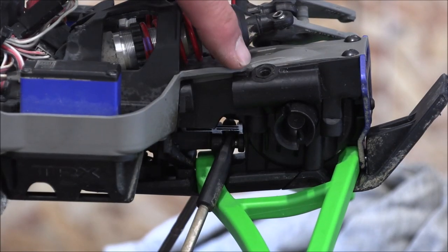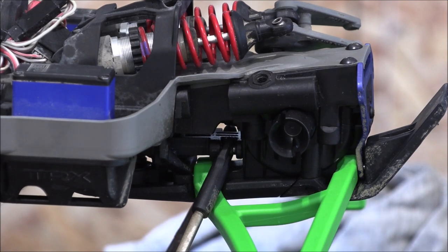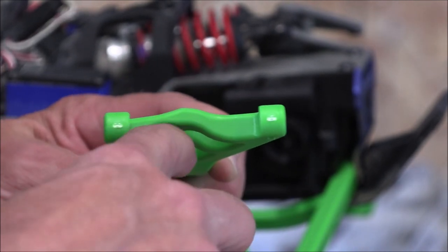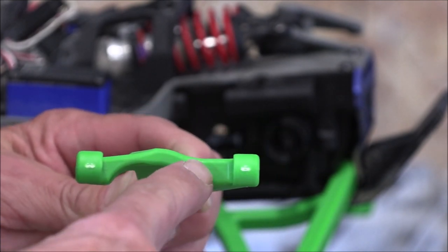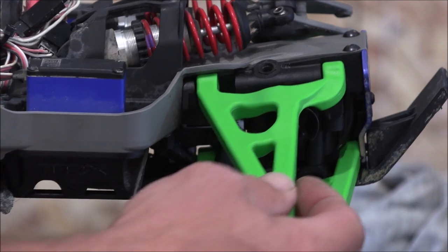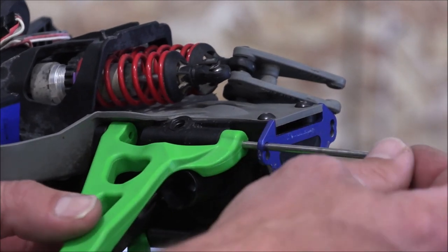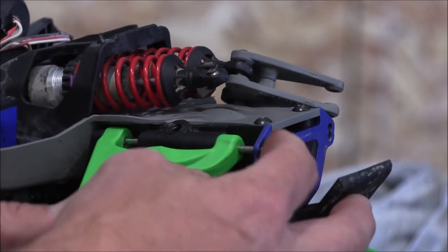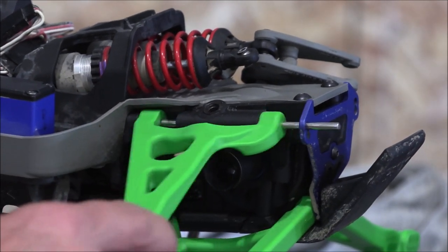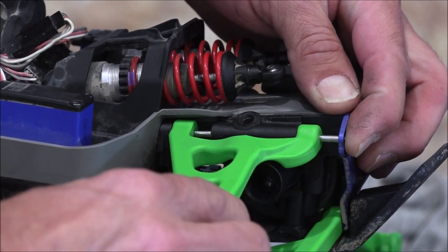I went ahead and took my rocker off just to give you a wide open view of where these go. So you've got your control arm here - push your pin through the top hole, which is the stock position. Now most people would think you're good, but no - this is where those spacers come in. This is what caster is: it's this distance here based on where your axle is and your wheel and your travel. You want this to be centered unless you're changing it for some reason, which will require lots of other adjustments.